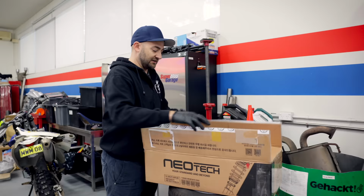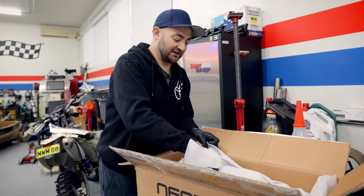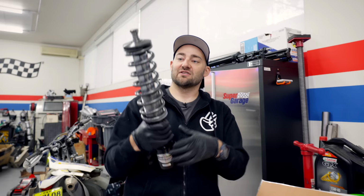So Chris from Shockworks, who are down in Melbourne, has, very last minute for me, created some custom coilovers for our Brumby. And this is super cool because on the bottom you have Forester spec, which fits our hubs, and on the top you've got Brumby, but he's also created a shock, like an inverted monotube thing, like a good one, that incorporates the lift. So we don't have to use the plates, which is kind of cool in terms of making it really nice and neat. And that will go into the front of our Brumby and hopefully be perfect.